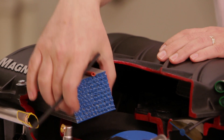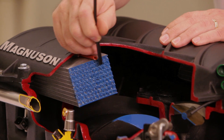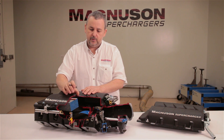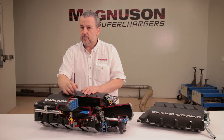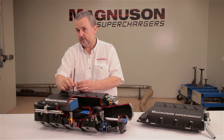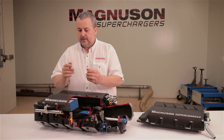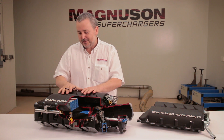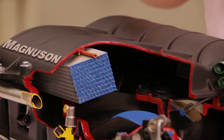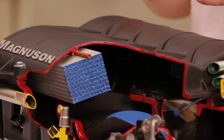Add to that this unique design of our charge air cooler, which is an extruded tube — not a folded tube — an extruded tube looped-fin type charge air cooler. It's the same technology that Formula One used for keeping their engines cool by running their oil through these same sorts of tubes. They are very, very efficient and they recover very quickly. This helps keep the heat soak down. And although it's nested in the V, the supercharger still has enough room for cool air to get around it.